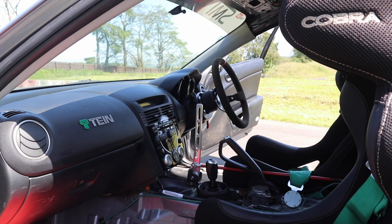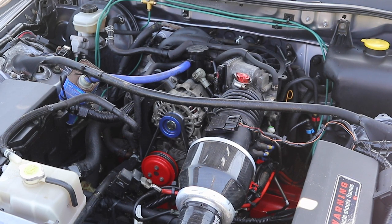Yeah, the engine's slightly temperamental. When the battery goes flat, you end up getting the OMP come on, and I didn't know what an OMP was, and it's an oil metering pump that pumps oil into the rotors. So when the battery goes flat, it confuses that, and then it's in limp mode. Then you have to reset that, and there's a lot of stuff that I had to figure out about rotaries. So it's a very different car to own than anything that's non-rotary.